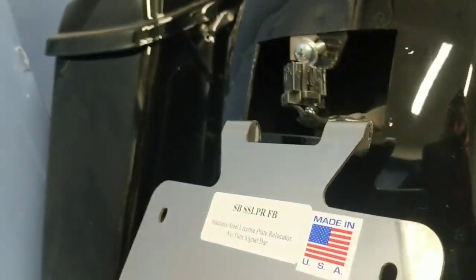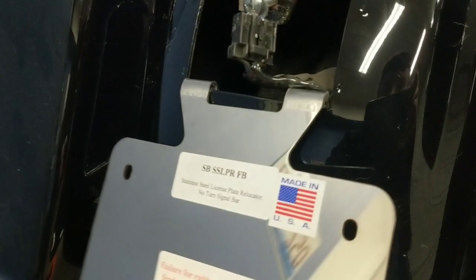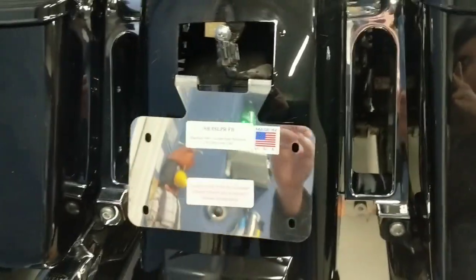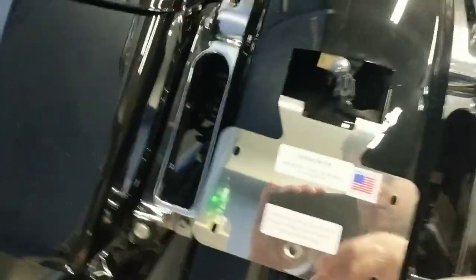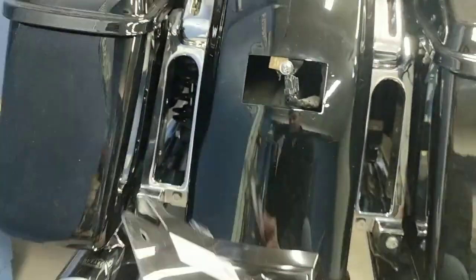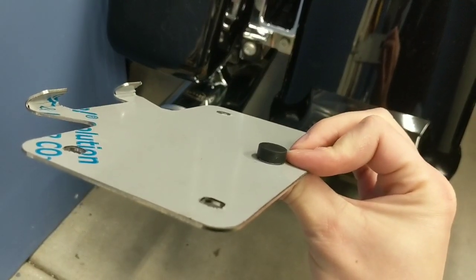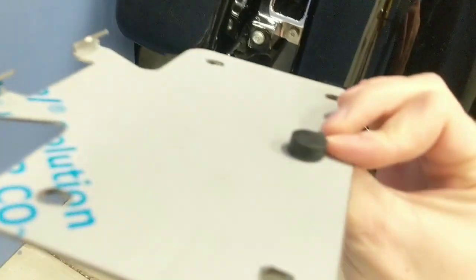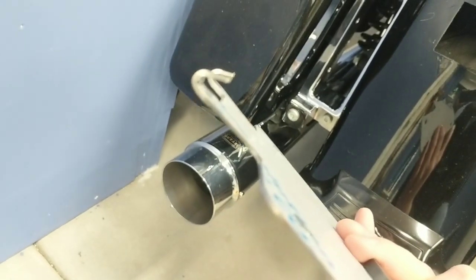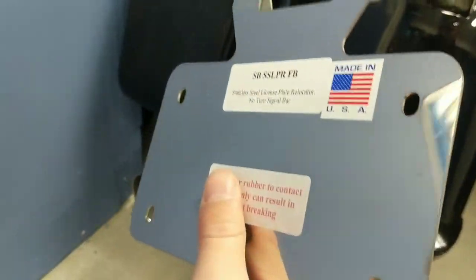Here are the little hooks. What you want to do is hook it onto your fender and play around with it for best fitment. Get it centered on your motorcycle, slide it left or right, and perfect the positioning so it's centered and not bouncing off anything. A really nice thing about this product is that it's got a little rubber stop on the back, so even if it makes some contact with your motorcycle, depending on how you've got these ears angled, it's not going to be vibrating or rattling. These ears up top are where you'll want to adjust to get the clamp-down tension right and get the angle of the bracket proper.